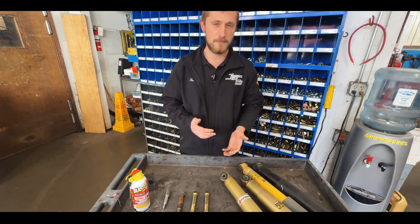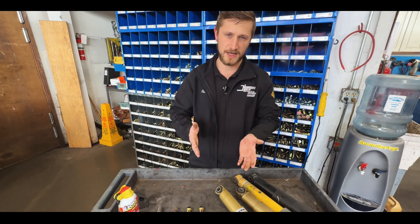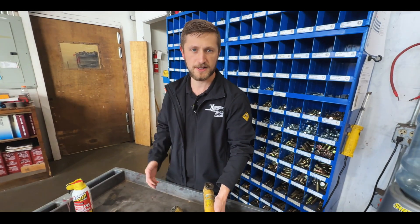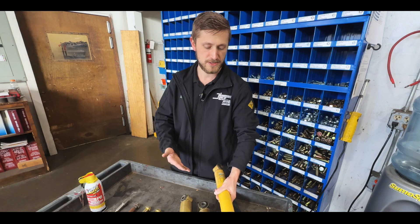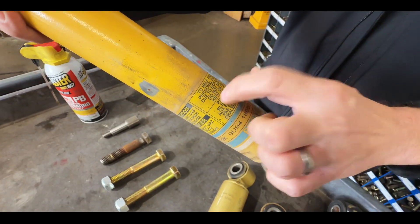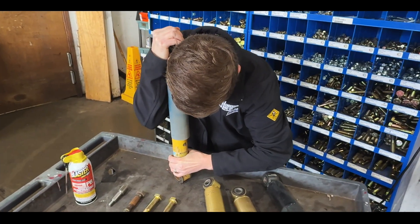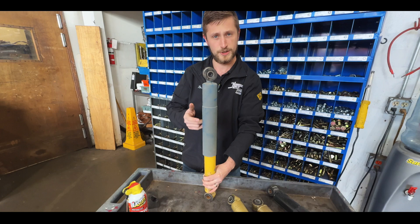The third tip is related to general misunderstandings of different types of shocks. Talking about shock absorbers, there are really two broadly different categories: monotube and twin tube. The most common example of a monotube shock absorber is Bilstein — we see this from the factory on some coaches, and it's also a common aftermarket upgrade. A monotube shock has a nitrogen charge in it, and that's what makes it want to expand back out on its own. Monotube shocks do that — that's just the way they work.